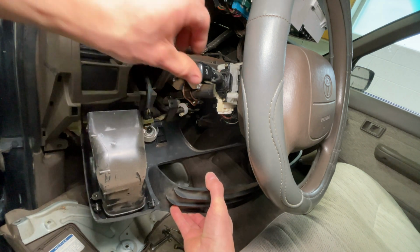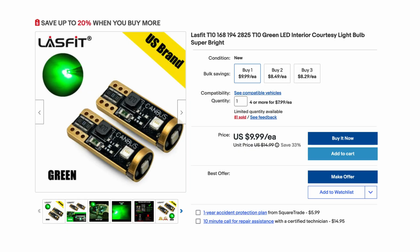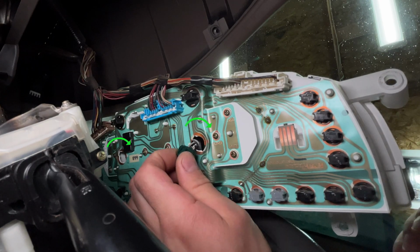Now turn on the headlights, or at least just the park lights. You'll need 2 194 light bulbs. 168 is the same size, but typically is a higher wattage and is used for outside marker lights instead of the interior. Now you know. Anyway, you can get these lights pretty much anywhere like eBay or Amazon. I recommend checking out the reviews a bit to make sure your $2 bag of 30 LEDs doesn't just burn out on day 1. Swap the bulbs and continue.